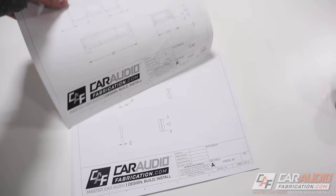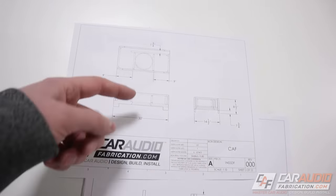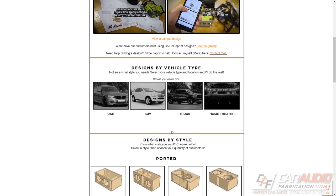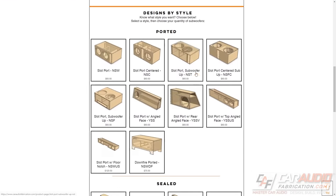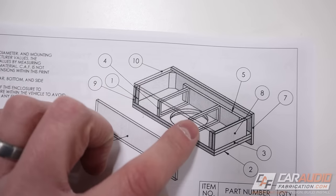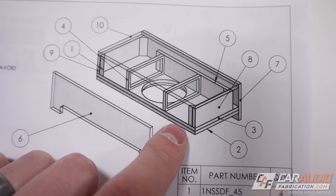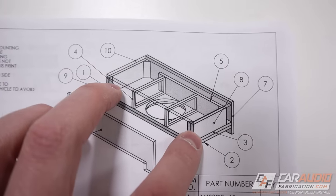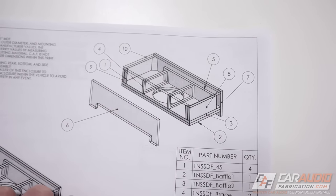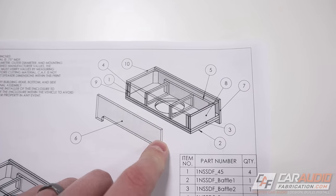I know that this can be complex, especially if you're new to car audio. I do have custom subwoofer enclosure designs for your subwoofer and for your particular vehicle and dimensions. You can purchase them on my website — I'll put a link down in the video description. On this design, not only do I have the port, I also have some bracing going on. We've got a double baffle to keep this extremely strong so we won't lose any sound quality to vibrations of the enclosure, and we have 45 degree corners to help strengthen it.